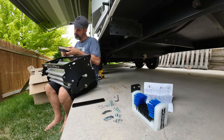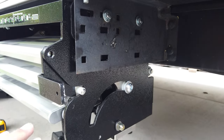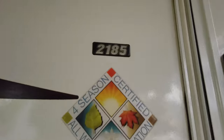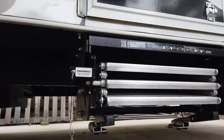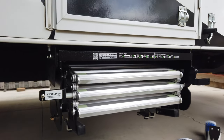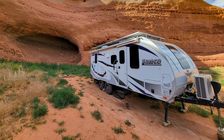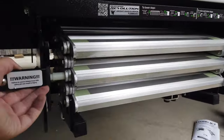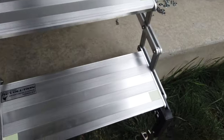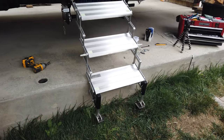I have successfully put the steps hanging from the vertical brackets, with the bolts just slipped in to hold it — it's not fully bolted on yet. I just wanted to briefly show the profile of how it looks on our trailer, which is a Lance 2185 travel trailer as a point of reference. We went with the three-step version. Two-step might have been more optimal, but I wanted extra reach for situations where the ground is farther away when boondocking. You can pull up on this handle, pull out on that lever, and the steps come out so you can see how it is positioned.